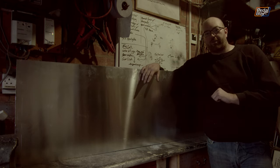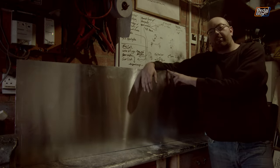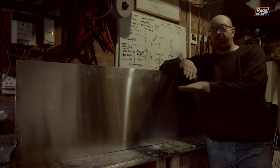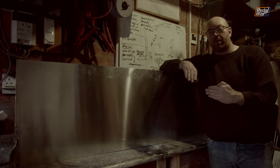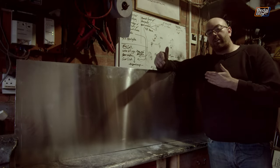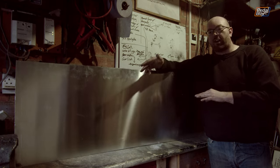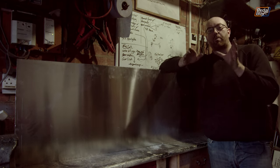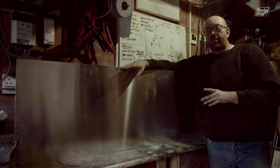Now we're going to do something more interesting with this big sheet of aluminium — we're going to build a diffuser. This is half a sheet cut down to 500mm top to bottom. The diffuser will fit between the exhaust tips on the back of the car, coming up from floor level at the gearbox mount all the way to just below the reverse and fog light cluster. The distance between exhaust tips is 680mm, so we're making this 640mm edge to edge, then rolling it around a piece of pipe for a nice large radius.